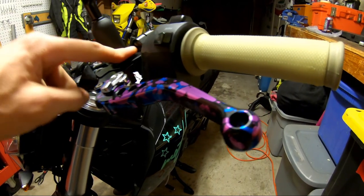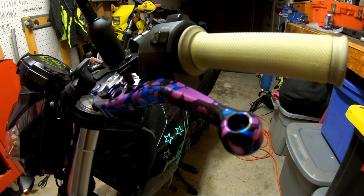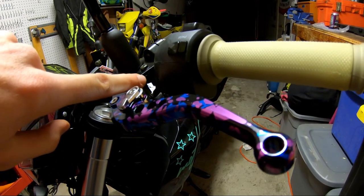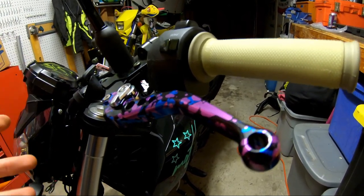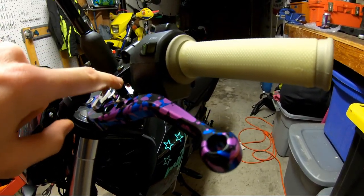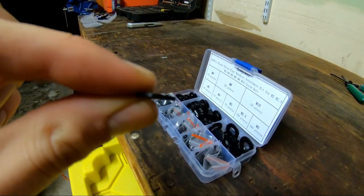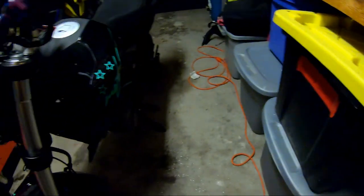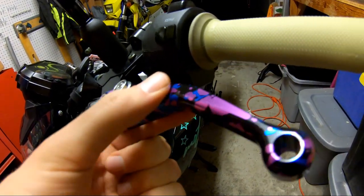The new lever is in and the bolt is tight, but it's still incredibly loose. So I'm going to thicken this section — taking a page out of Kraken's book. That's another YouTuber with a Benelli, Kraken's Garage, who does a lot of great videos. What he did is what I'm going to do: thicken the pivot area with some nylon washers. I'm going to sand one down slightly — the thickness is just a little too much — just enough to wedge it in there and eliminate the up-and-down play.